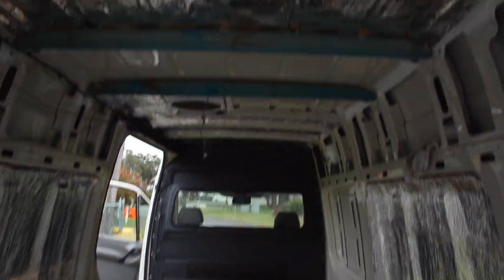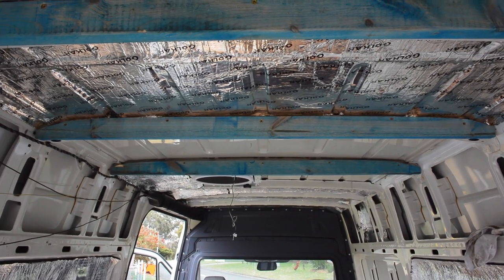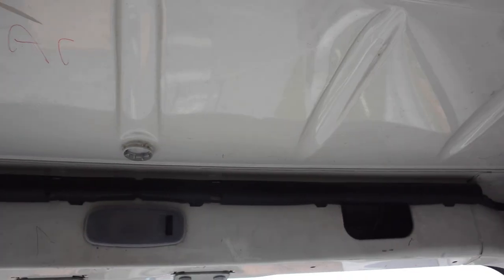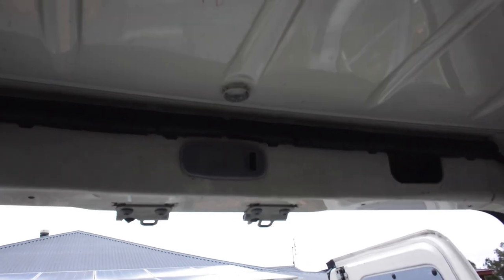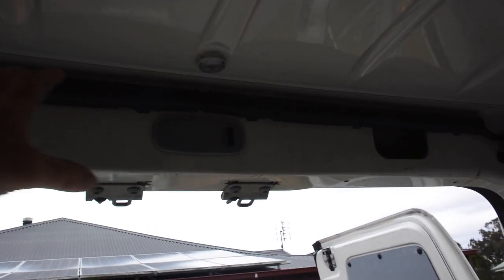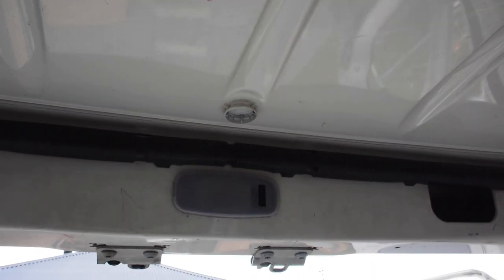So these are all nice and straight, beautiful. What we're going to do now is the back one, because the aircon sort of rests on this. You can see it's heavy, it's bowing down. I'll take these wires out, put a board across the back, and then I'm going to brace it, either one or two. From here, I can screw it straight to there. Easy.